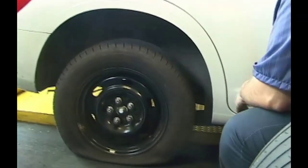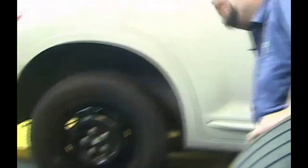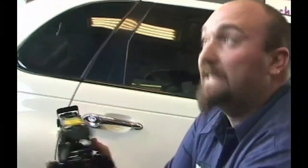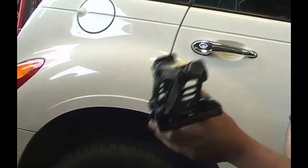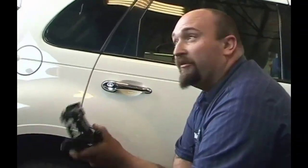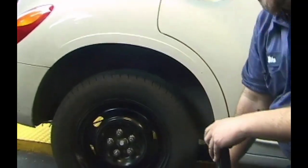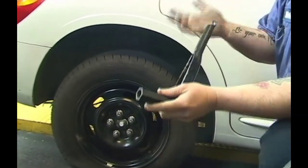At seven years, you might put the spare on, get five miles down the road, and it blows up because the tire is ten years old. In your owner's manual, they'll have specific jacking locations laid out. For your scissor jack — this little device will pick up a big truck; the mechanical advantage these things offer is huge. So don't think that being small means you won't be able to pick up your car. In your owner's manual you'll have the locations of the jack and the tire iron — several different styles exist, but get that stuff out, look at it, and get familiar with it.